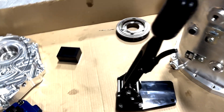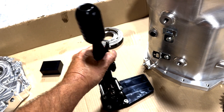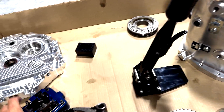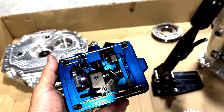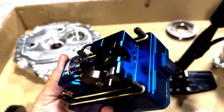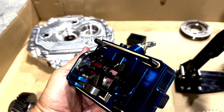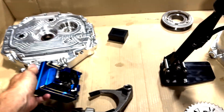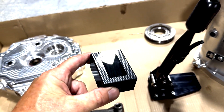This is the heart of the system, and this is the shifter here. You've got a lever here that puts it in neutral and reverse. This sits on top of the Magnum where the normal shifter goes — like where the mid-shift conversion goes, right in the center. And you've got the gear selector sensor here that tells you what gear it's in, and that projects it onto your gear selector screen box, which will light up and show you what gear you're in.